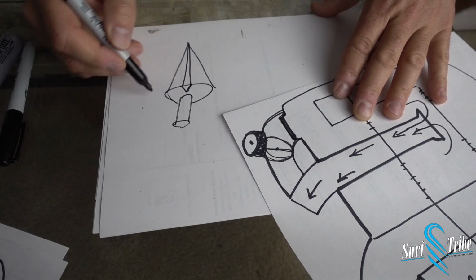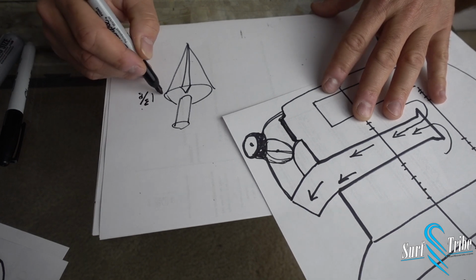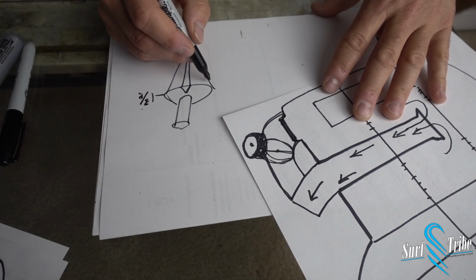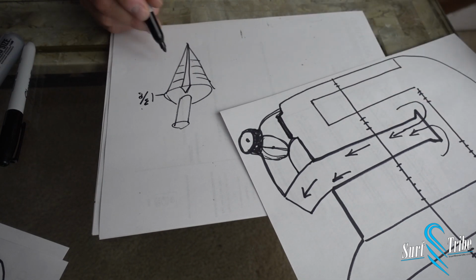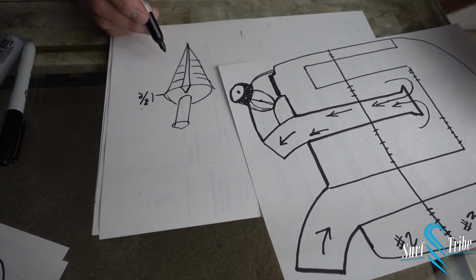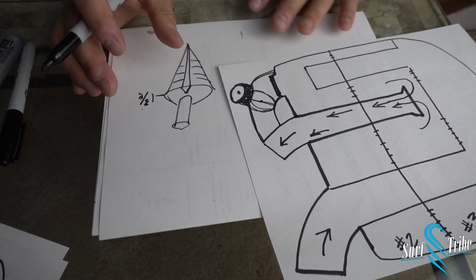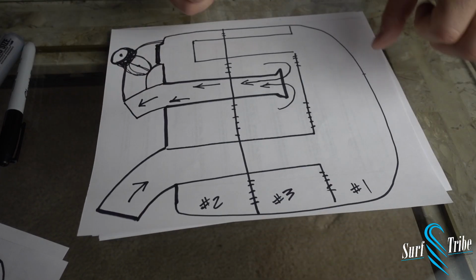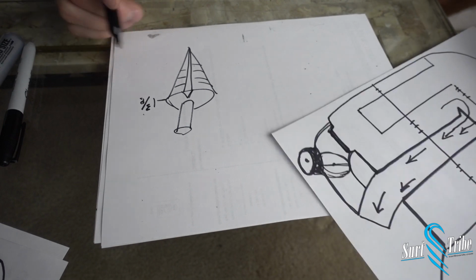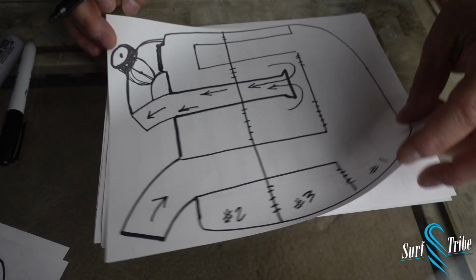And I think it was an inch and 3/8 maybe is the thickest one, but the step drill bits, they look like that. I used one of these. It drills much easier. I have a 1-inch drill bit, a standard 1-inch metal drill bit. Trying to drill through that, holding the drill would definitely bite and twist, and you'd never be able to do it. So definitely go buy one of these. You need one of these.